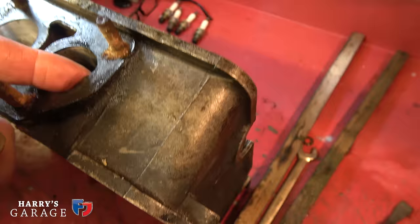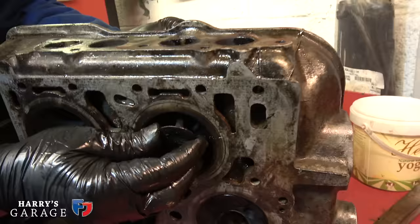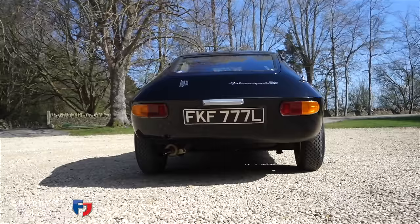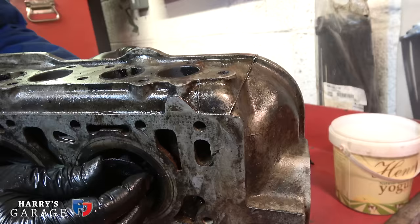Those have been cut, haven't they? Yeah, they are. Not quite back. But that one, that's ridiculous, isn't it? Right, it's just an exhaust valve then. So I suppose that, because it's canted over as well, the top of that guide is always in oil. Look at that amount of movement. That's my smoky engine, isn't it? A lot of my smoky engine is there.